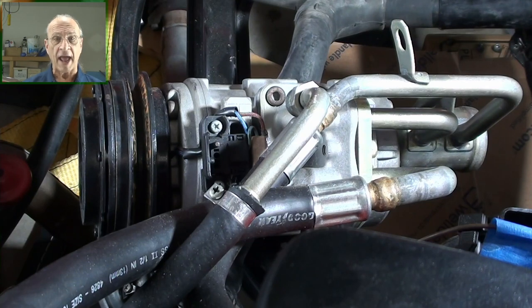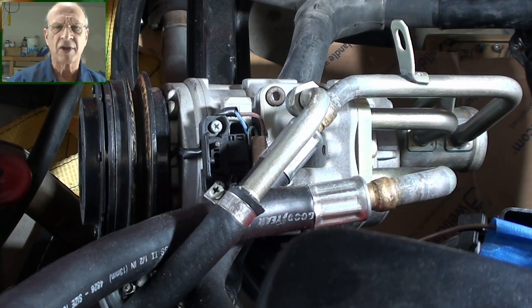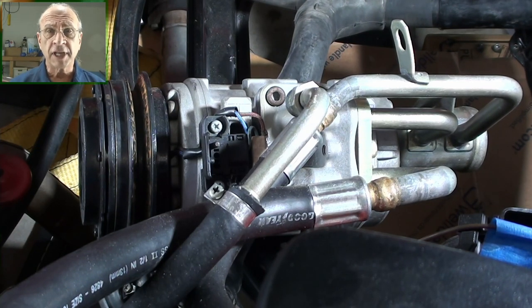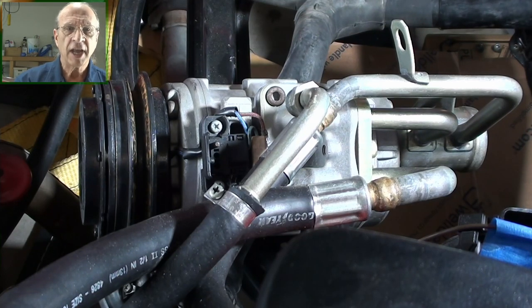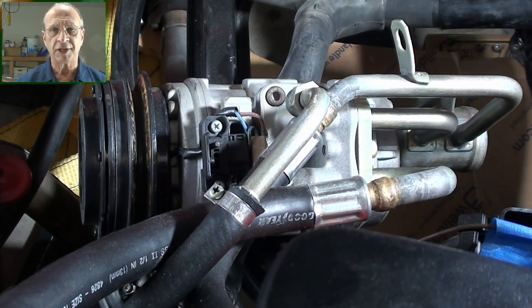All I'm doing is just a simple test to make sure that the clutch engages, that the pump sounds good, that it seems like it's working, that there are no bearings that are shot, and that the pulleys all run freely. I could have also tested the gap between the clutch and the actual pump, but it really doesn't matter. I know it doesn't rub when it's not engaged, and when it's engaged it actually holds on to the pump.